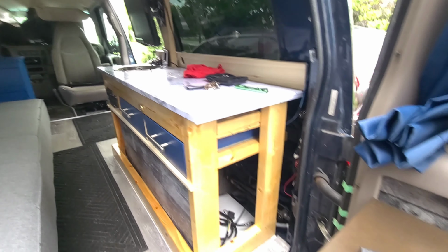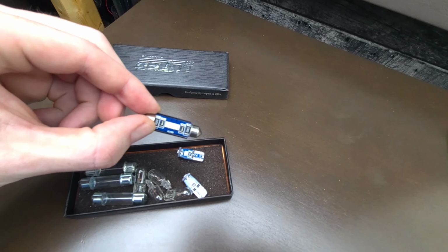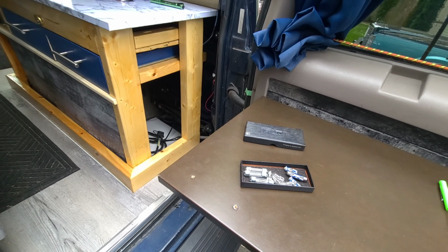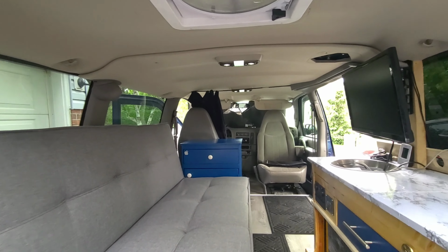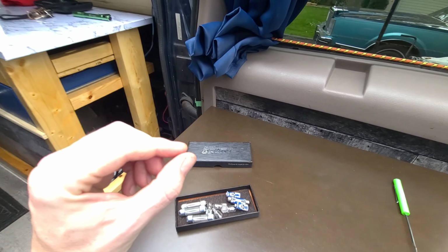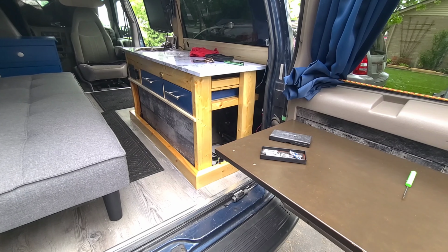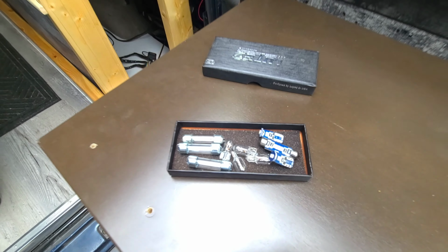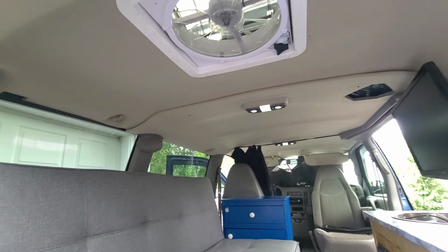And they must have the little CAN bus microchip in them, because I didn't get a single one of them backwards, so it probably doesn't matter which way you put these ones in. In the early days of LEDs, when you had to order them from shady people on the internet and they came in paper towel from the middle of Toronto, you would go through the trouble of putting the LED in, and sometimes they were so tiny, for like the little bulbs that go in the HVAC of some cars. You'd really hope that you put it in right the first time, because it's almost impossible to get the little LED back out of the socket. These ones would be okay, they're huge. But it used to be a guessing game, 50% chance, how's your luck?